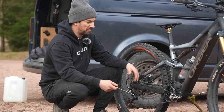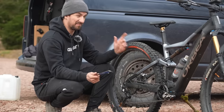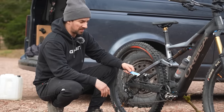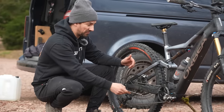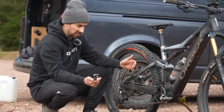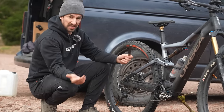One of the most expensive consumable parts of your bike is your drivetrain. Your grips and tires wear out too, and tires are expensive — we'll get onto those in a minute. But if you let your drivetrain get too worn out, eventually you'll have to buy a chain, cassette, and sometimes even a chainring, because if you just put a new chain on an old cassette, it'll slip just as bad. Cassettes, particularly these days, can be a lot of money.